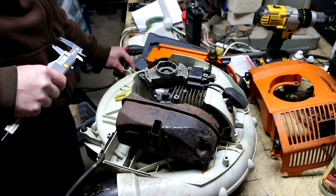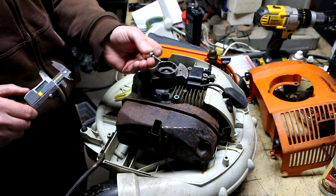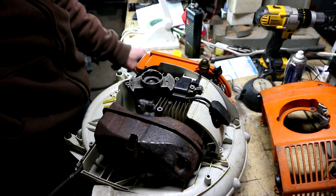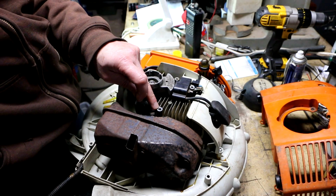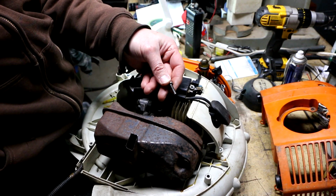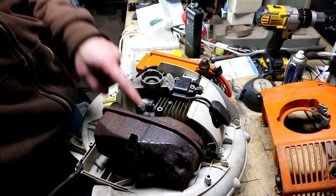So it leaves me with these screws, which all appear like they might be M5. The problem is this one is 20 millimeters long, and these 3 that match are 24 millimeters long. Well, I'm kind of puzzled here because neither one of the M5 taps that I have fit this. So then I took one of these screws, which I thought was the right screw. It doesn't want to screw in correctly. And when I tried to measure the thread pitch on it with my thread pitch gauges, none of my thread pitch gauges match this. So I think I got a couple things going on here.